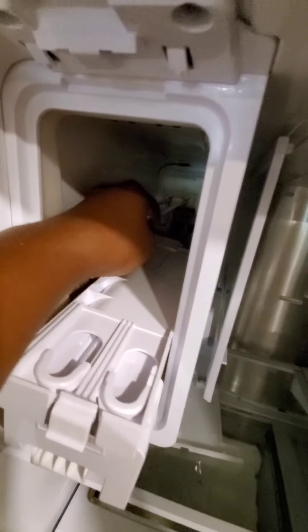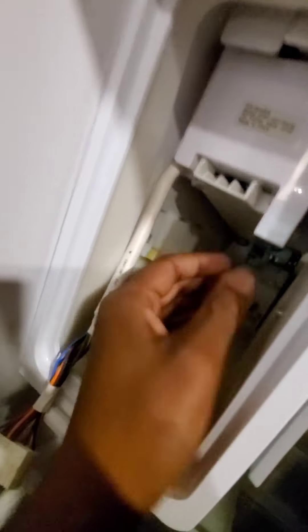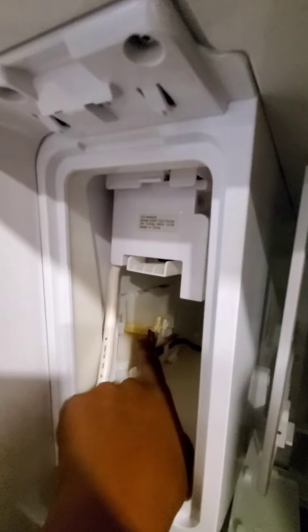Let's tilt this just a little bit — not too much, you don't want it to break. Just slide it up in there with one hand, pull this forward to you and snap it in place. Make sure you push that evaporator coil up, then close this. Hit the bottom of it, push the front up. As long as you see that this is in, you can land your screw and reconnect your ice maker cable.